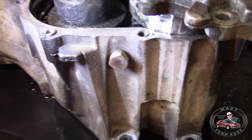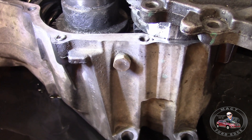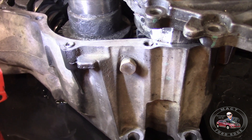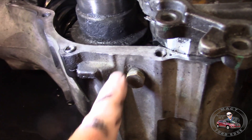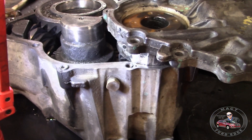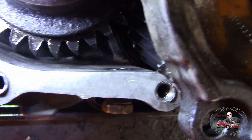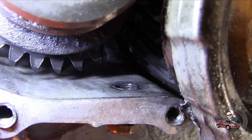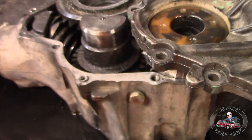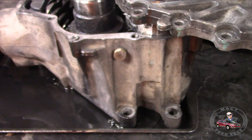That's pretty simple. You want to get a couple of different size drill bits. Basically, start with a drill bit half the size of what you want, drill carefully without going too deep, then break out the next bit that's the right size, tap drill that, and apply the tap. I would use a tapered plug — you wouldn't even have to tap all the way in. Make sure your plug isn't too long either; use a short plug, it'll drain right out. This is the thickest accessible part of the entire casing and it's at the bottom of the PTU, so that's where you want to be.